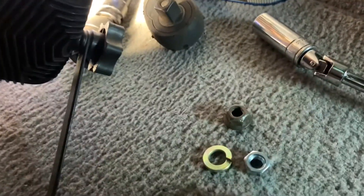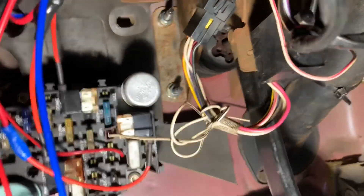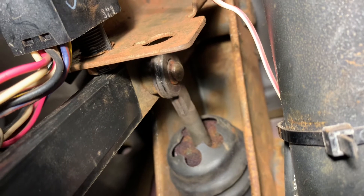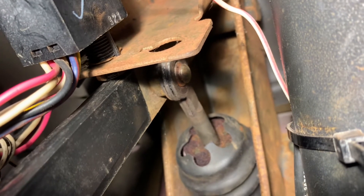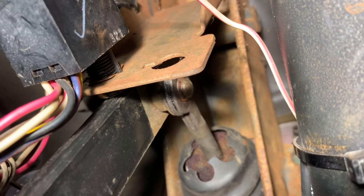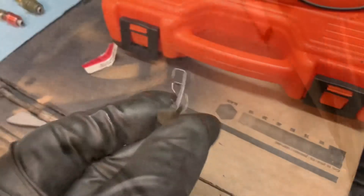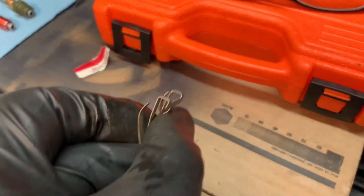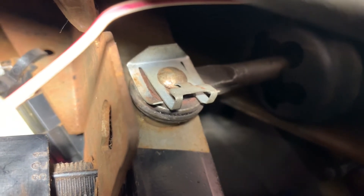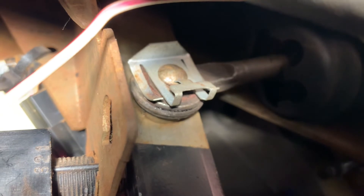Replace the nuts, add the swivel and lock washers, and you're done. Make sure you reinstall the little clip that goes around the brake pedal prong — the rod that sticks out there. One day you'll be going down the street and that power brake booster rod will come right off if you forget it, and that won't be a pretty sight. Here's what the little clip looks like — it just goes around that little shaft. I went and put it in right now while we're thinking about it. Clip installed — she's in now and it's official.